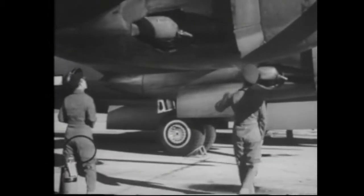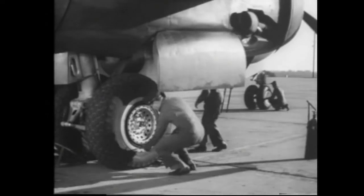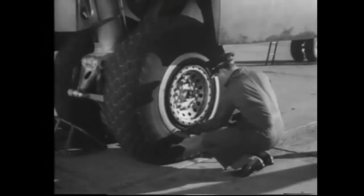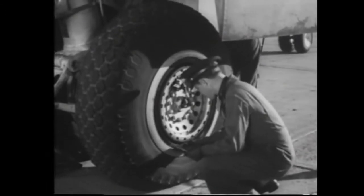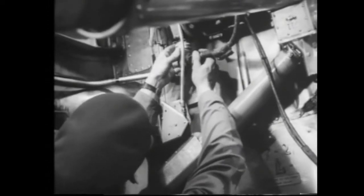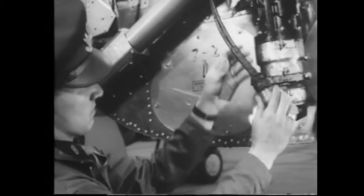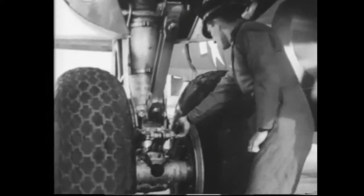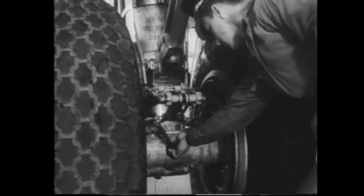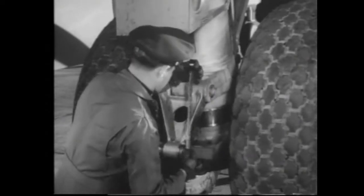Now you can look over the engine cowlings on your way to the other main landing wheel. This gets the same inspection you've already given its mate. The co-pilot ducks into the wheel well to inspect the equipment there, while you work on the wheels. Measure tire pressures again. On these tires, the pressure should be between 75 and 85 pounds per square inch. Inside the wheel well, the co-pilot examines the wires, connections and switches, making sure all the cannon plugs are on tight, paying particular attention to the plugs on the motor which opens and closes the nacelle doors, and also to the plugs of the normal and emergency landing gear motors. Then he turns around to examine his side of the strut, inspects the brake lines, making sure that the hose is not chafing and no fluid is leaking. Meanwhile, you're checking the clearance between pin centers again — thirteen and one quarter inches. Right.